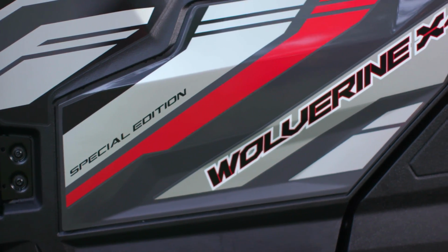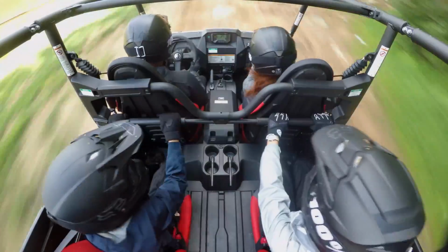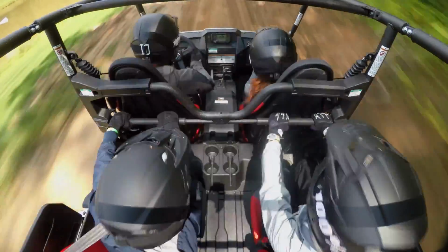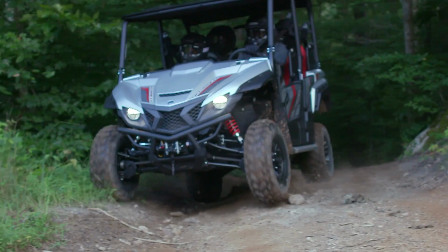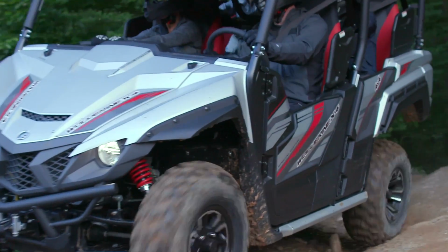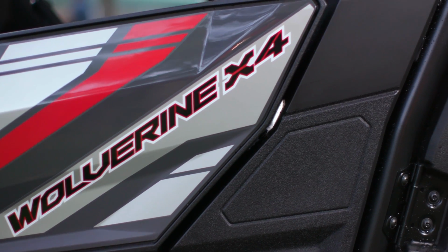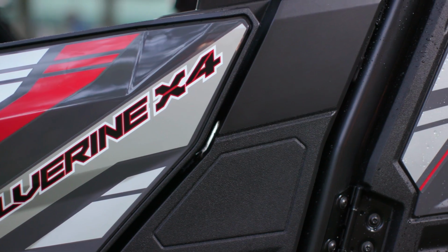It's built like a tank with forged pistons and rods. This high RPM 270-degree firing motor is dry sump and said to deliver stellar power throughout the entire RPM spectrum. Mounted into the new X4 chassis with rubber isolating engine mounts and utilizing a geared counterbalancer, this is sure to be one of, if not the smoothest Yamaha motors to date.